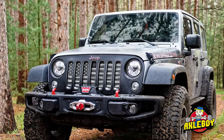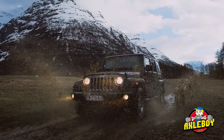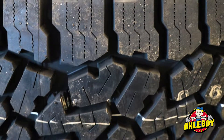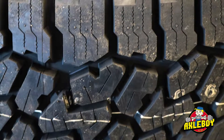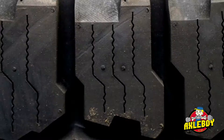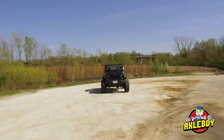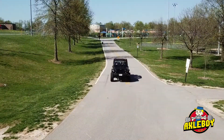If you're planning on doing some trails or getting into mud or grassy fields, it's definitely not the choice. The next step up is the all-terrain tire, which has larger lugs that can grab and get a bite. There's also rain siping — those small thin cuts in the tread. All-terrain tires stay pretty quiet on the highway and typically carry a 50,000–60,000 mile warranty.